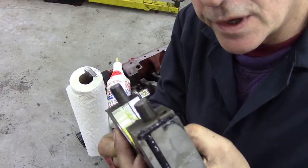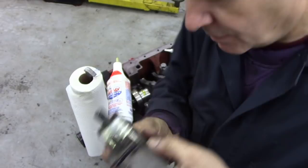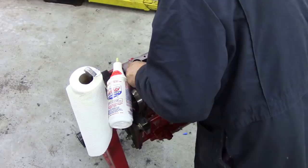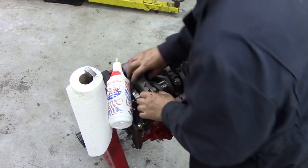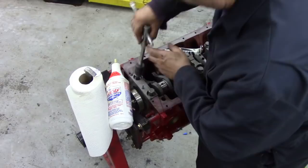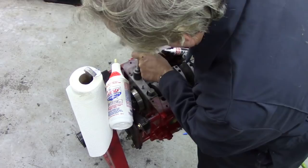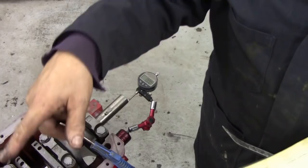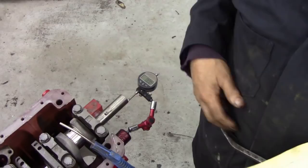In the book it says squidge all the way through from the top, but I find that by giving it a head start it's easier. Get the cap on the right way around — you can only go one way around with these caps because they've got little dowels in, so that's a good thing. Drop it down, get our little tommy bar and wind that down. The socket's the wrong size so I'll have to go and change it. The next thing we're going to do is locate our mag mount on the end of the crank — I've set the DTI to zero.